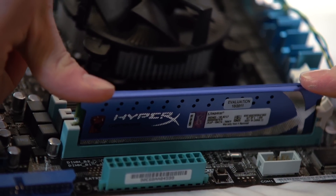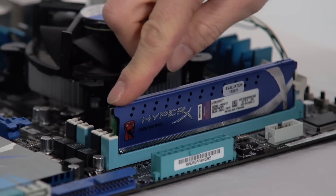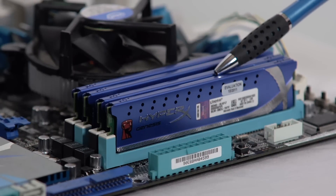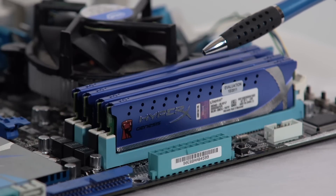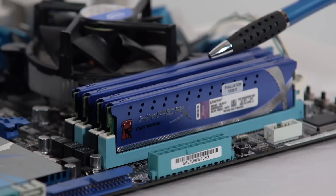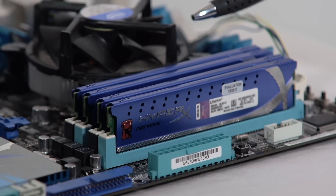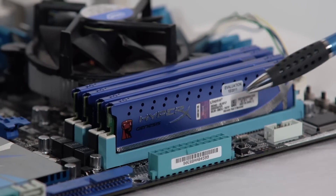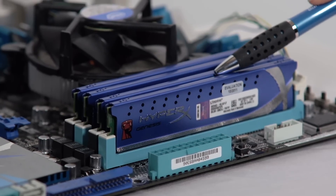You can easily check the latch sides to make sure the RAM is in all the way by visually inspecting the latch itself, or give it a quick push to ensure the RAM is firmly seated. After that, rinse and repeat until you've installed either your two sticks or your four sticks. Then boot up the system and use CPU-Z to verify that all of the memory is detected. You can also check in Windows — note that Windows Home Premium won't detect more than 16 gigs of RAM. It is normal for the megahertz detected in CPU-Z to be one half of the advertised DDR speed, because DDR 1600 megahertz is double data rate 800 megahertz.